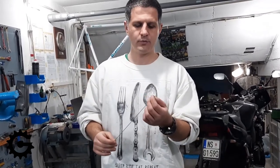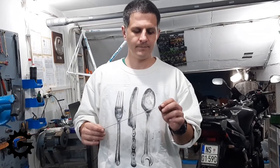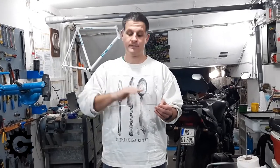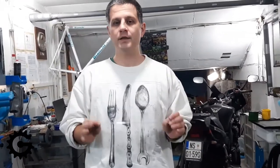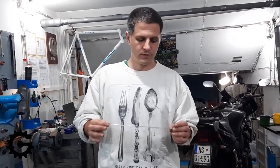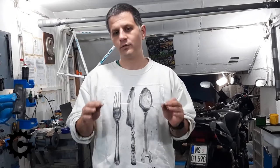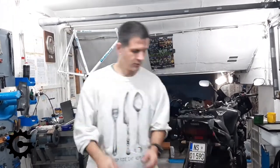There are also extra-quality spokes where the elbow side — usually the failure point for 2mm spokes — is made to be 2.3mm, giving a 2.3/1.8/2mm profile. Such spokes are considered extra strong. However, in my experience I haven't managed to notice any difference, and nobody I've built wheels for has ever had problems with standard 2/1.8mm spokes. That's as good as it gets in my opinion, and especially good value for money.